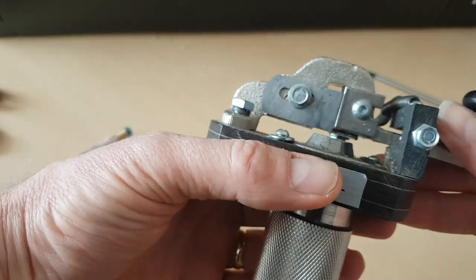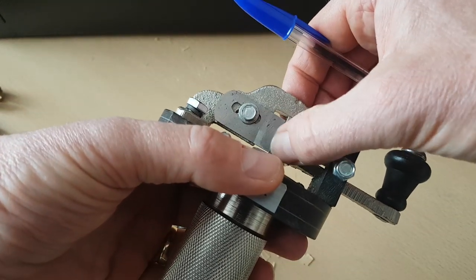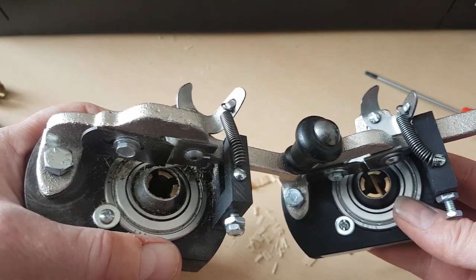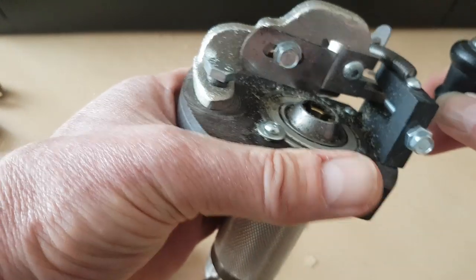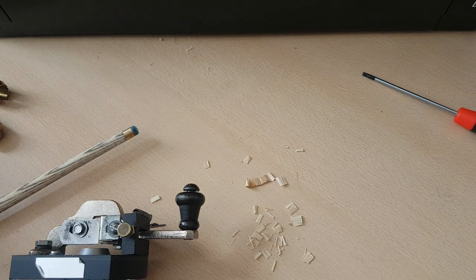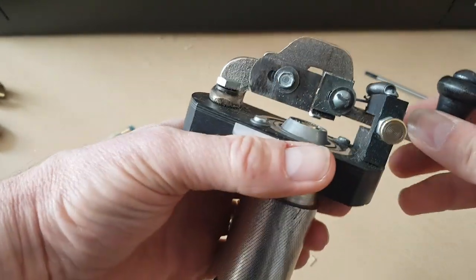This is one that's been used for a while, and you should be able to see a lot more distance there. If I run my finger across I can still just feel that bottom blade. The reason I've got a bit more distance is that the tension spring tends to wear after a while. You can probably see the difference in distance between a brand new one and this one. Once they wear, the armature tends to sit further and further away and doesn't have as much pull coming back inwards, so you end up having to adjust the blades. When you get one that's really worn — like one a customer sent me — even with new blades it just wouldn't cut.